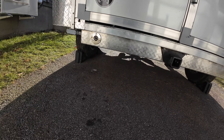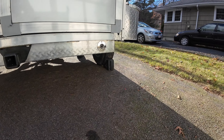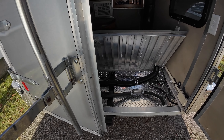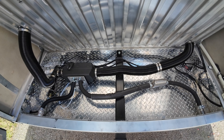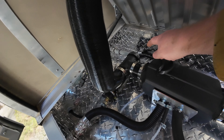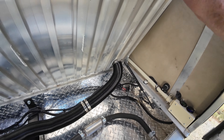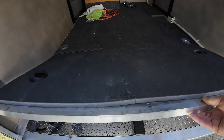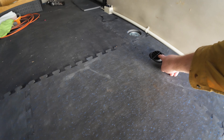Outside you'll see through-hull ports — marine grade — that's the air combustion intake and the exhaust for a Planar 2D diesel heater that I've installed in the underfloor storage box. We have the recirculation coming in from here, there's a half-inch conduit to pull in some fresh air as well. The heated air rises over here, and we have our silencing muffler — recirculating draws in there, heats up the air, and comes out here.